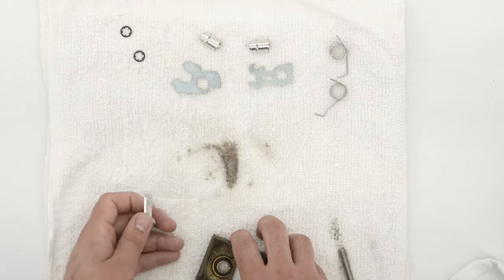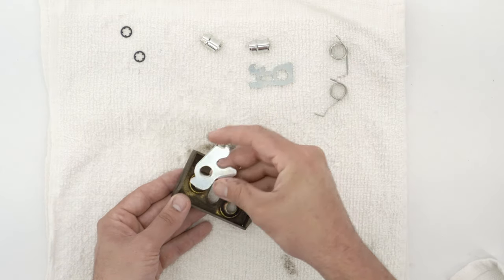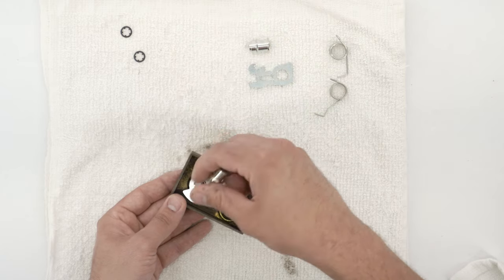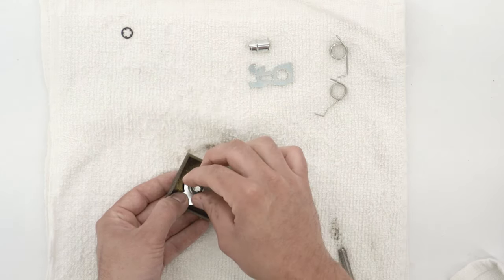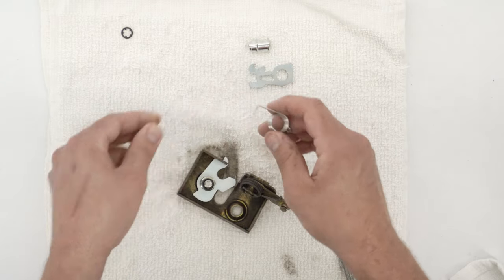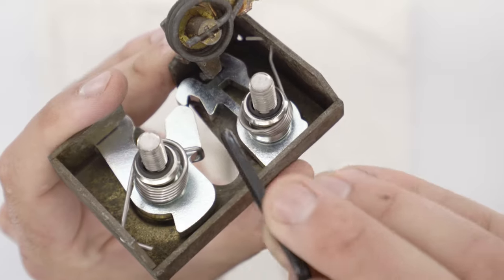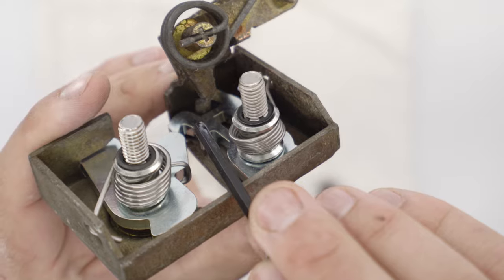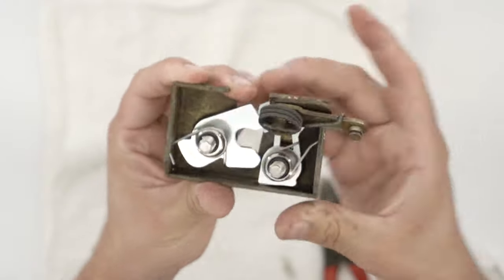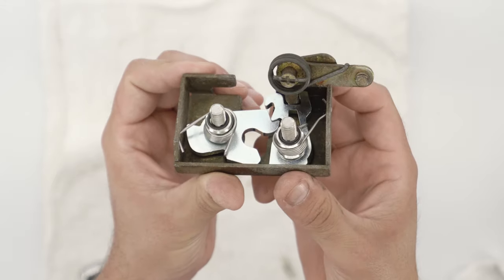Start by holding one of the provided bolts on the back side of the latch. Then place one of the catch pieces over and then lastly the post. Follow this up by threading on one of the retaining clips until it is tight. With the new latch piece firmly in place, install the thicker diameter spring. Then install the lower latch the same as you did the upper, making sure this notch contacts this section. With both retaining clips installed tight, make sure the new latch clicks twice.